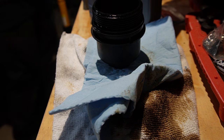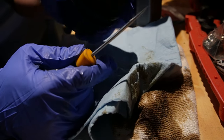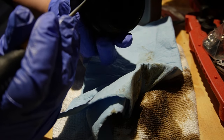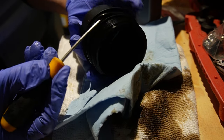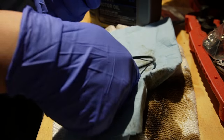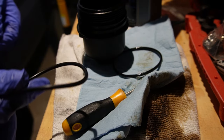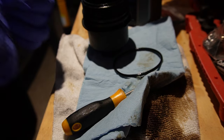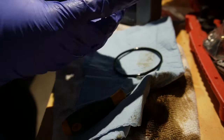The viewing angle isn't great and it's late at night without much light, but I'm grabbing my pick tool — it doesn't have to be anything fancy, even a toothpick would probably work. We're looking for a groove to stick the pick tool into and guide the old o-ring all the way out. We're not reusing the o-ring anyway, so if you want you can just cut it off, but be careful not to damage the threads on the oil filter cap. And there it is — the old o-ring is out.